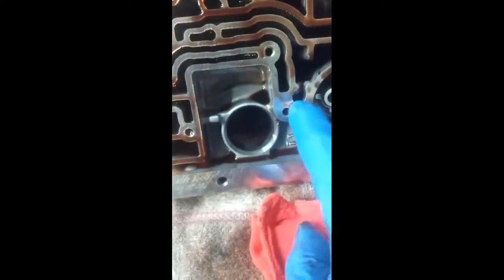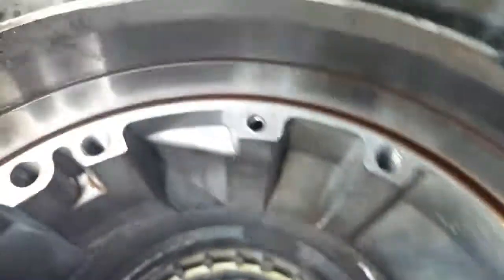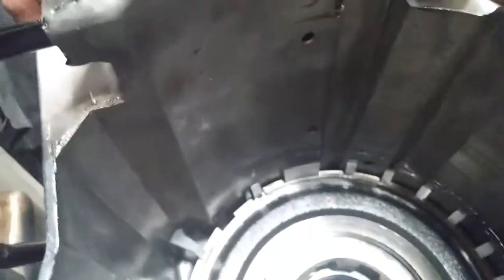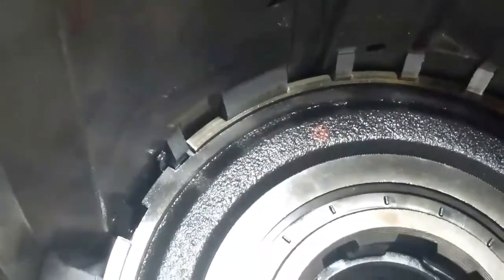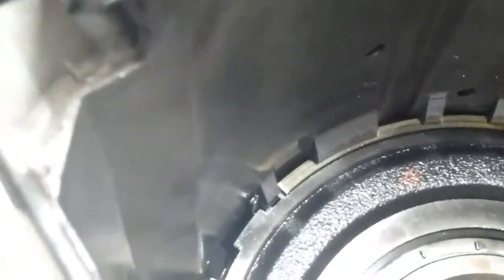This is for my own edification — it's a hard angle. On the valve body side, that's where the anti-clunk ring goes. You can see the snap ring stops there, and the curved part of the clunk ring goes there. This is the bottom-left, or top of your screen — that's how that anti-clunk goes in for that snap ring.